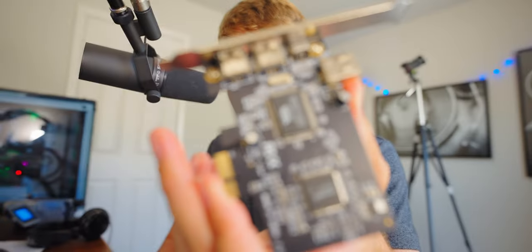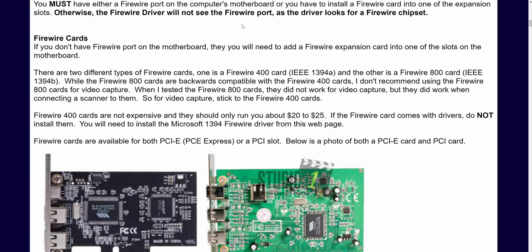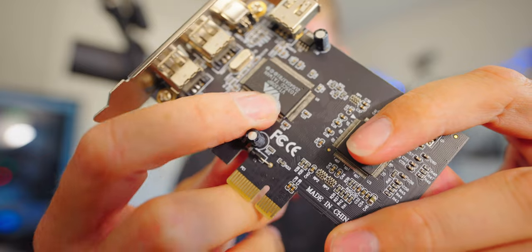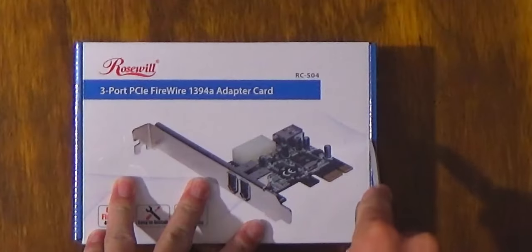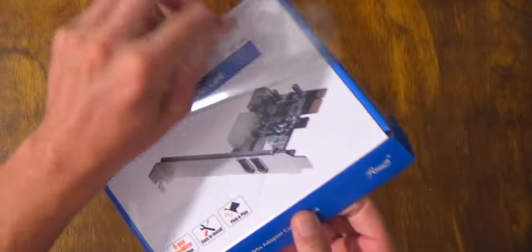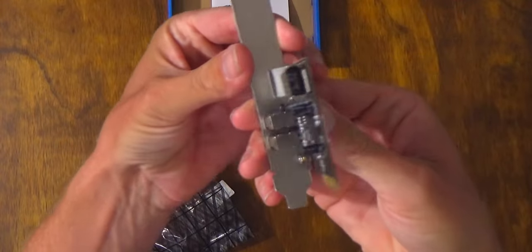Maybe you need to use a Windows 10 PC like me. You will need to buy a Firewire add-in PCIe adapter card. There's a detailed article about which card to buy. In short, you will want a Firewire 1394A 400 6-pin card with a VIA chipset. The VIA chipset is older and far more compatible with the vast majority of Firewire 1394 devices, such as this Canon camcorder. It's older than the Texas Instrument chipset. The TI Firewire 1394B 800 9-pin card is far more popular in search results, despite being less backwards compatible. So before you buy, you want to check the photos of the product and the description. Brand name doesn't really matter in this case because the performance is limited by the chipset.